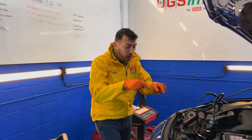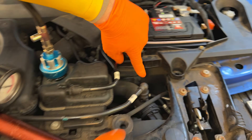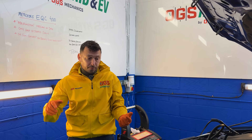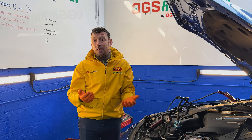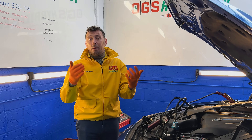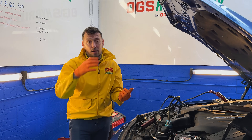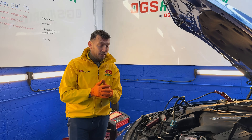So air conditioning is critical. Down here, those aluminum pipes are coming to the heat exchanger. Through that heat exchanger, the coolant is flowing along with the air conditioning. Air conditioning can bring the temperature down to around zero degrees, which keeps the coolant temperature very low, and then the coolant flows through the inverter and charger to keep them at a safe temperature.